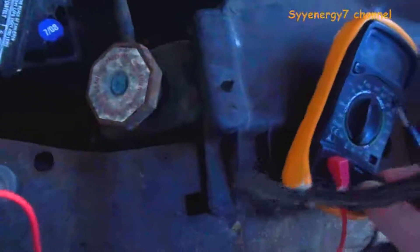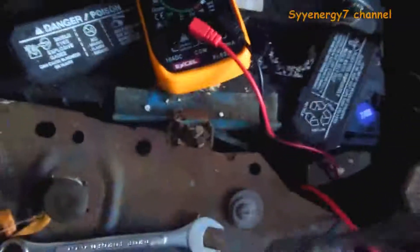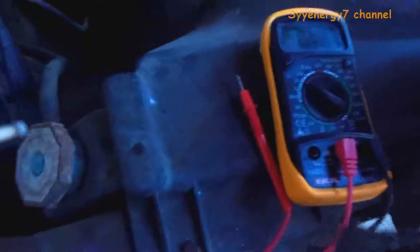I was curious about trying to bring this thing back to life. This is actually a deep cycle battery, and I'm realizing the other battery got killed because of a slight parasitic draw. Checking the resting voltage — you can see it dropped quite a bit. Resting voltage should be around 12.7 volts. It'll start the car if it's got about 12.1 or even 12.0, but once it gets below that, forget about it.